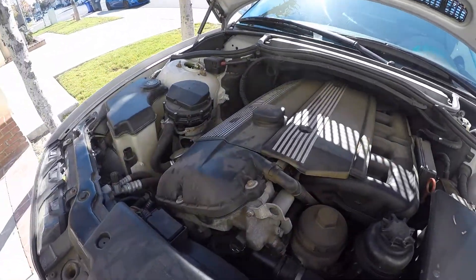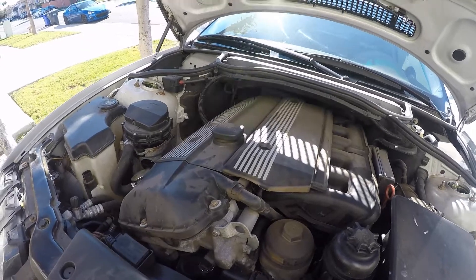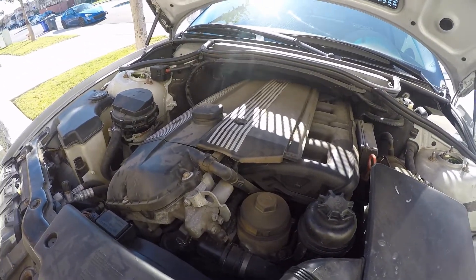What is up YouTube, Nuisance Carl here. I want to talk about something — last time I went to the track with the E46, I actually had an issue with cooling. The car got a little bit hot, up to about 117 degrees Celsius, which is above the operating temperature of the E46. I think the max you should go is around 105. That's a big no-no because E46s, and actually quite a few BMWs, have such a long engine that the moment you apply a lot of heat to it, it tends to warp and you end up with an expensive head job.